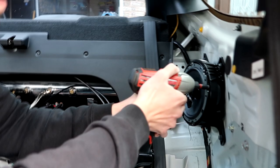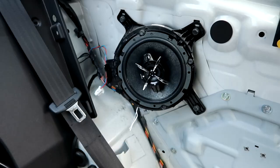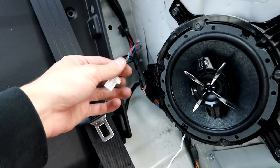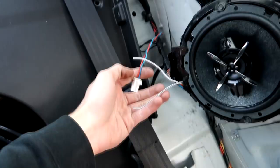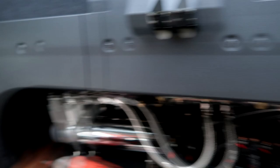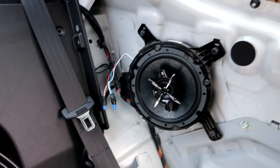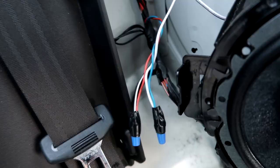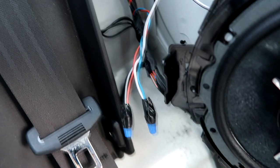Now that this is in, I'm going to get to the wiring part once again. Here on the driver's side of the car — also known as the left side of the car — the blue wire is the positive and the red wire is the negative. So when you splice these together, make sure you're doing the negative to the red wire and the positive to the blue wire. And when you do the other side, which I already did: the green is the positive and the orange is the negative, and that's on the passenger side of the car.